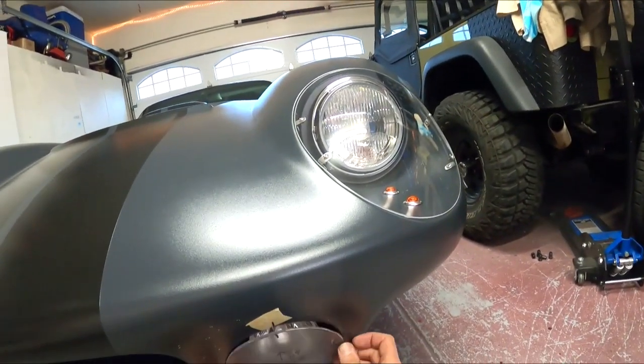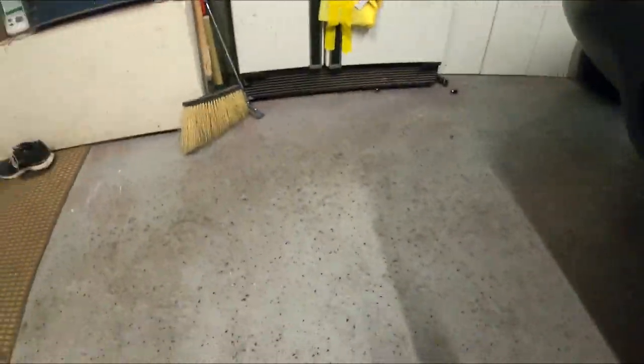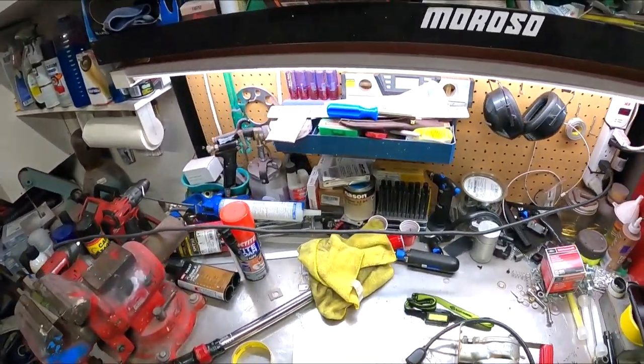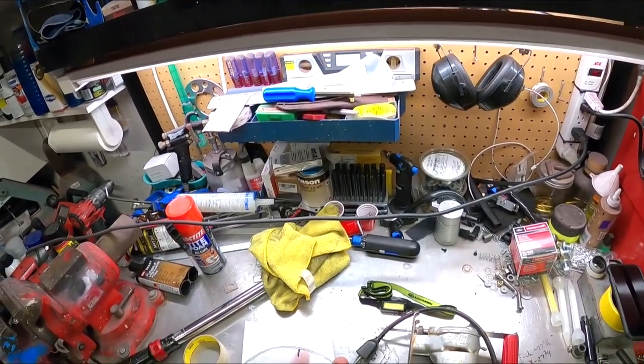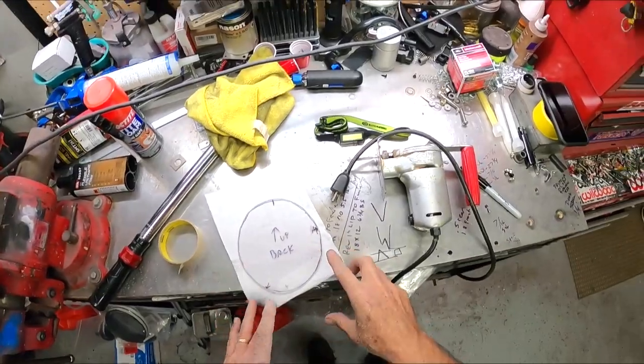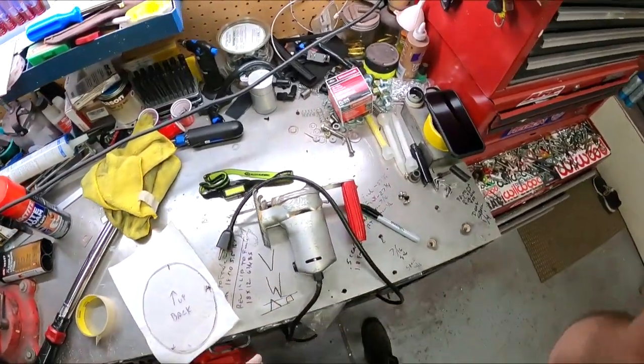So kind of match the headlight covers. Definitely takes time. So now I'm gonna get a block with some, probably start with like 220, and just start working the edges a little bit. I gotta work this bottom edge and then just carefully continue to work this whole thing until it fits in. And then I'll show you how I get the brackets in.